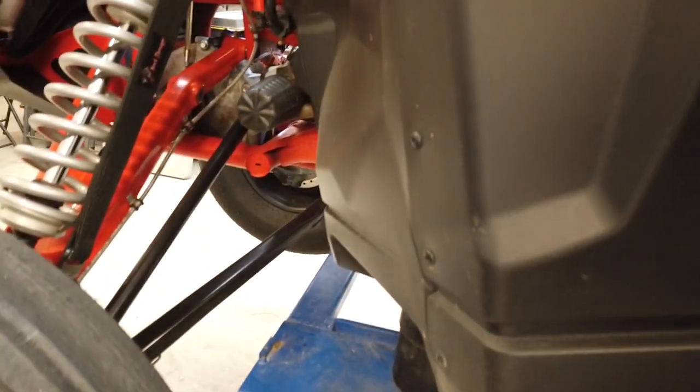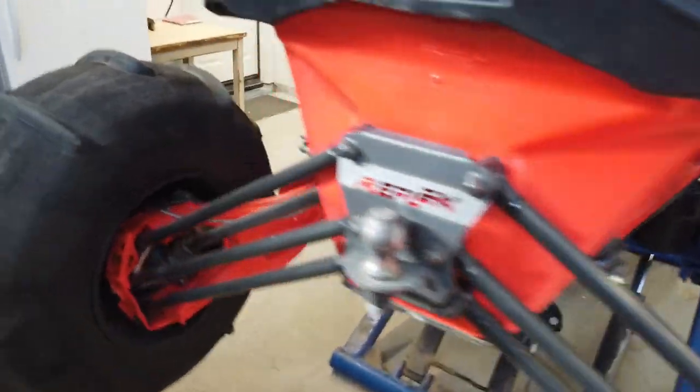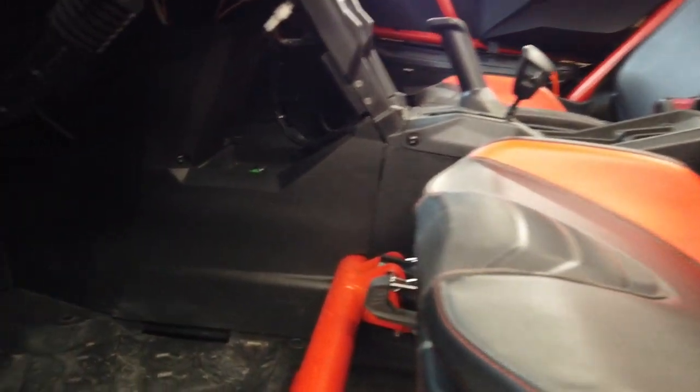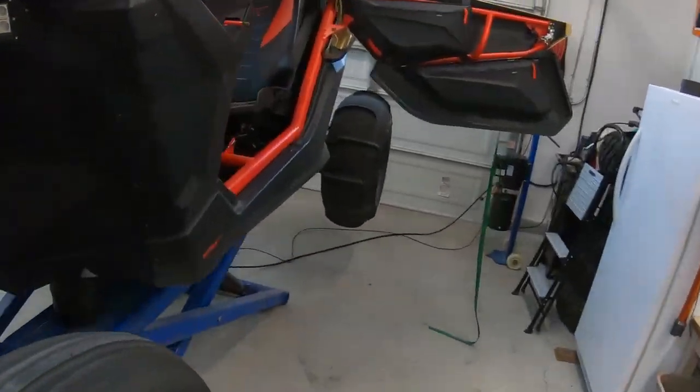I had this same issue on the Razor before. There are soft coolant lines coming out of the radiator that go back into some hard lines. The hard lines go down through the tunnel of the car to the back to the engine — you can see here where they come out and go to the engine, providing coolant to the thermostat and so on. What I'm gonna try today is take the tunnel cover off on the driver's side to expose the driveline and the cooler lines and see if anything is loose in there.